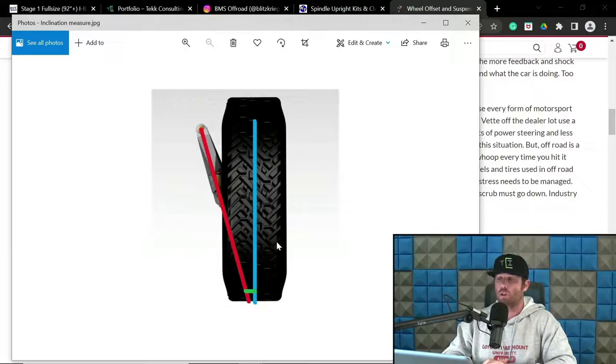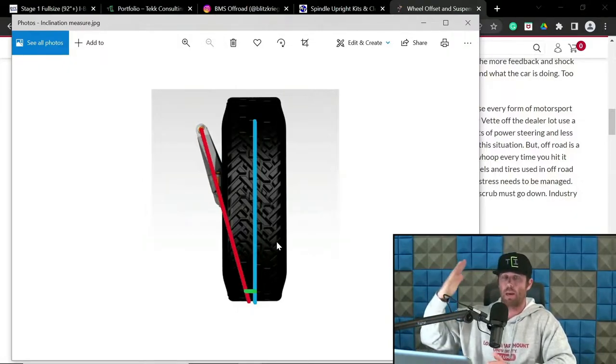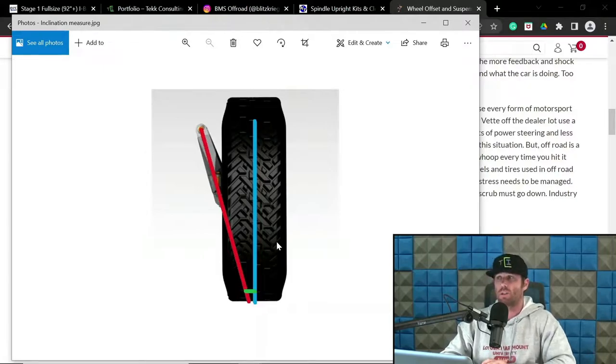And again, that's done because you're going to have extreme camber gain at compression, and you want to avoid having that scrub inverse at compression, or inverse too much at compression relative to the contact patch, so to speak. And this is in reference of a straight line. So obviously through a turn, that changes because the tire would then be more upright through the turn, especially if you're referring to the exterior tire at camber gain. So I hope this is not getting too confusing, because this is just a lot of cool stuff to go through. And again, this applies primarily to the rear-wheel drive truck scenario with a lot of camber gain.